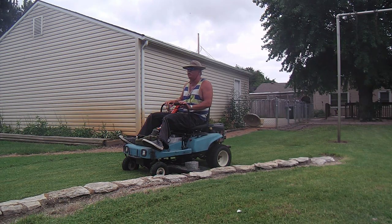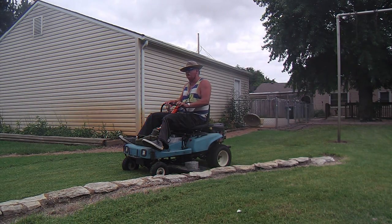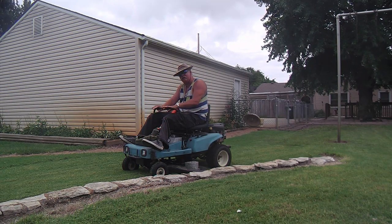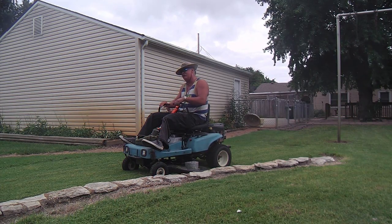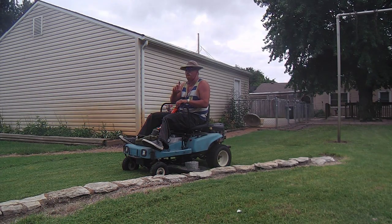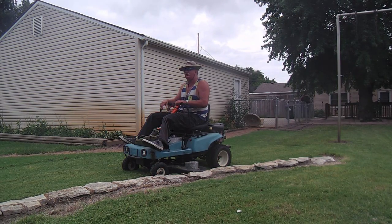I've spiffed it up pretty good. I think the left side here is still a little fast. I'll slow it down and get that. But it runs out the same when they're fully extended. So I don't know, maybe that's just the stiffness of the preload on the torque bushing springs. I could loosen that side up a little maybe.